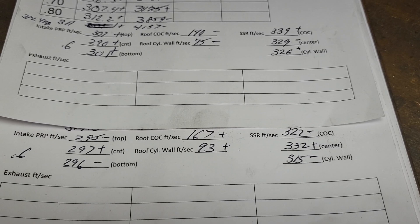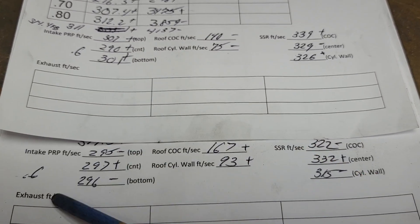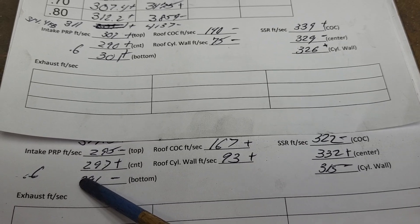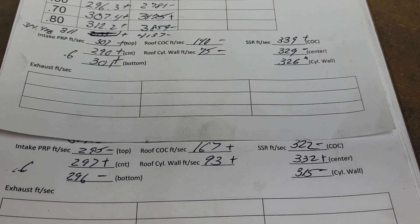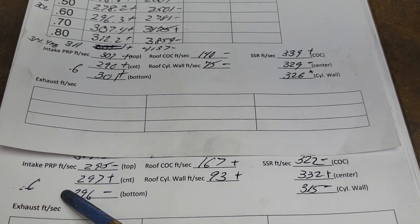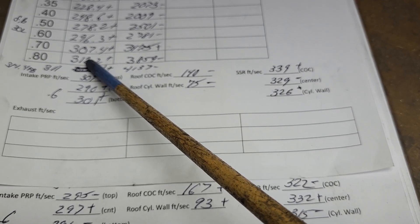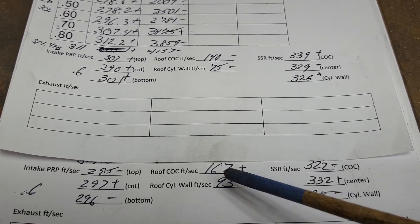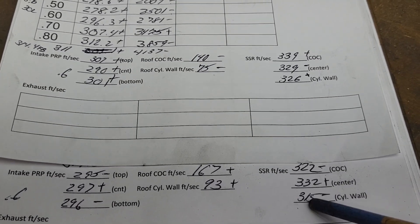Let's take a look at our airspeeds. The top one is our 31st cut, the bottom one is our 32nd cut. How do we do on our pinch? Pinch is the same size, same lift - minus, plus, minus. Notice how close they are. Pinch is working quite well the way it is. Does that mean it's not holding us back up here? It probably is. I could take more metal out of the divided wall between the two cylinders. It's right around 300 at 0.6 - when I start to crank it up more and it exceeds 300 CFM, that speed goes up. How do we do on our roof? The roof actually picked up - the roof liked it. How do we do on our short side? Minus, plus, minus. Pretty close. These weren't bad either, as far as speeds.